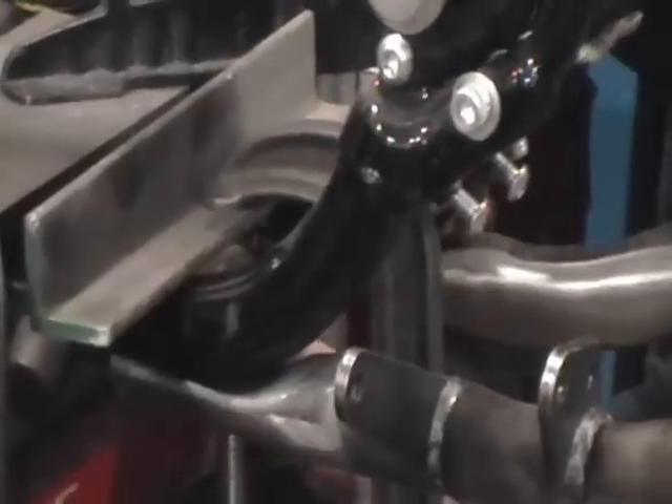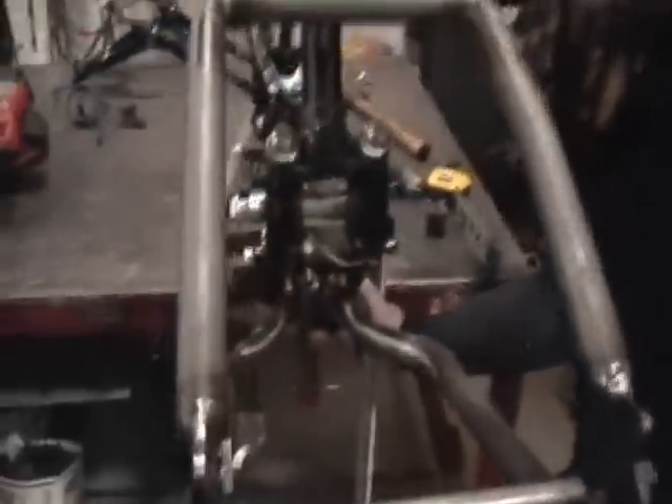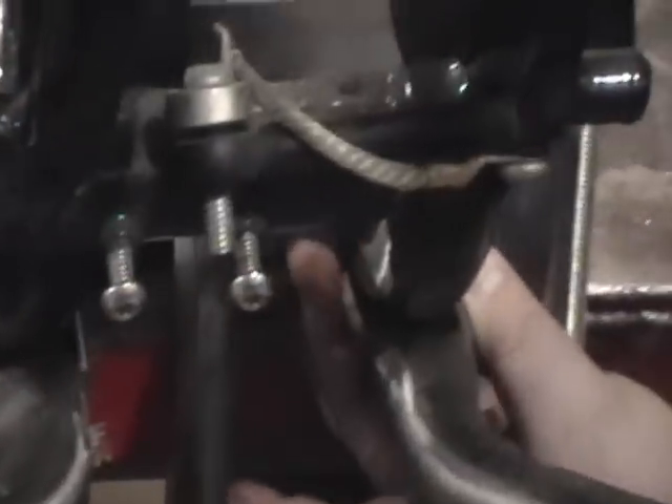The most critical thing in my mind is getting the axle slots level. Then get it so the axle far forward without any cocking is the same distance to a known center point on the frame. You're going to want to get it up into this location as far forward towards this really heavy C-channel bracket that comes from the factory, as far forward against that as you can, and get the lower rails pocketed up into the cupped part of the tubing as it comes.